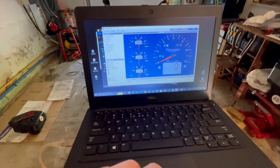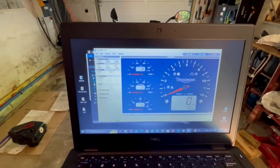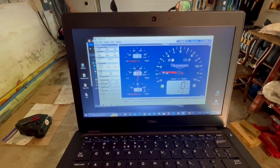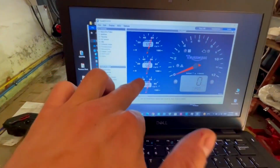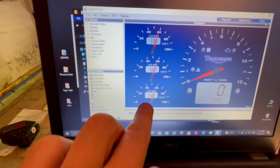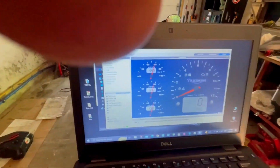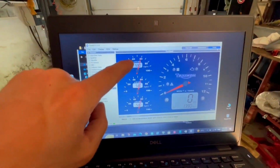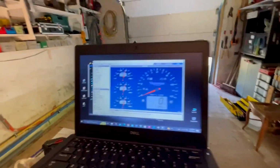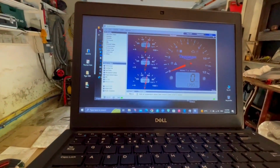You can also hear when I run the bike. It's really powerful ignition, really powerful startup, and the revs are really good. And this is very, very stable with the new electronics installed. The engine management light I will reset. But as you can see now, these two are not synced with this one. So I'm gonna put them onto 6600. I'm gonna start with cylinder one, then align two on one, and then align three on two. I'm just gonna flip the throttle and see, it's gonna reset.